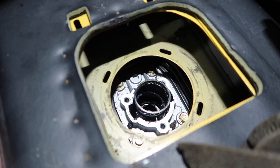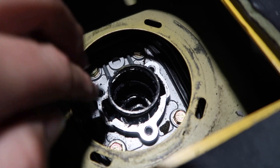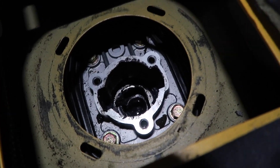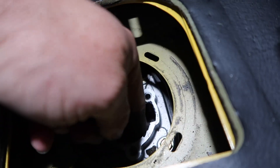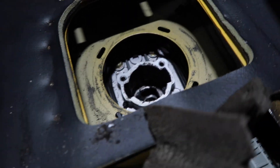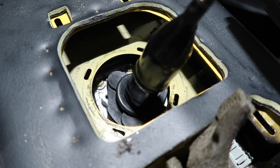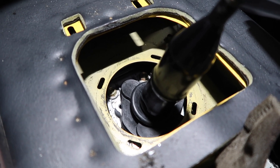Alright, so we're in the car putting the shifter in. As John mentioned, there can be some corrosion on the inside of this. It would be easier for you to see if you remove the spring, which usually stays in. This all looks fairly good — feel in here too, feel for ridges or anything suspect. We're going to take our new shifter parts, all nice and greased up, put the spring back in, and get it installed. Also, what I found helpful is if you put the spring all the way down and put it in reverse, the shifter will hold itself there without bolts in it, so it's much easier to put the bolts back in.